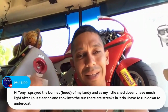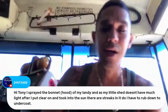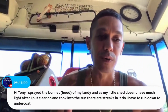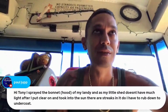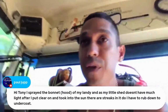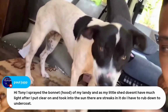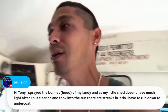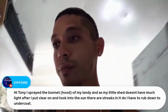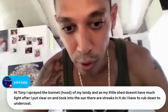Yes, if you're going to be putting any type of paint on top of that, whether it's more clear coat or if you want to do new base coat and then clear coat, I would sand it down with at least an 800 grit for clear coat. If you're going to re-base coat it, I would just take it down with 400 grit, buddy, and go from there. Okay.